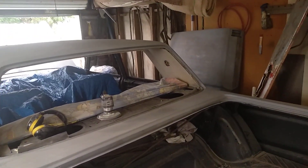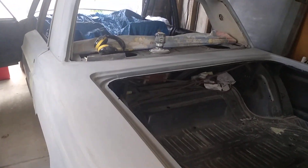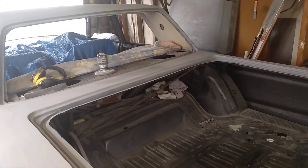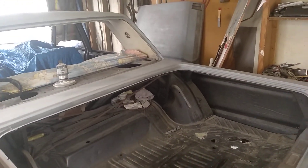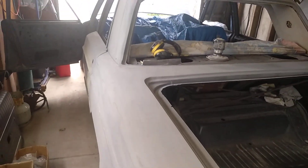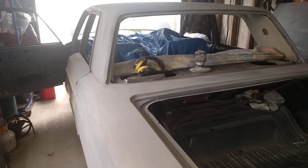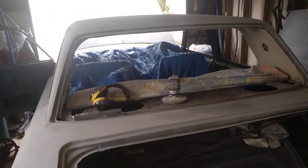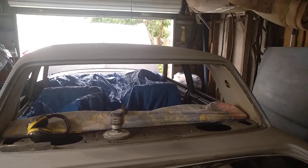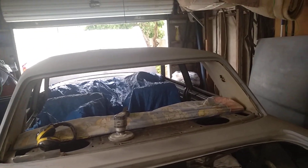I'll just try and make it a little bit more presentable than what I had it, with all the yellow body filler and everything showing through bare steel. I'll just try to clean it up a bit better. So yeah, that's what I'm doing at the moment. I wasn't going to do much more, but I just decided I'm a bit bored and I haven't got much else to do apart from clean up and sell a bit of stuff. I thought I might as well just do a little bit on it. I'll touch up those bits in the roof with a bit more body filler, to cover up all those holes and sins they put in it.